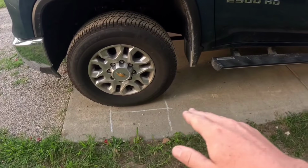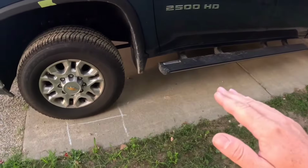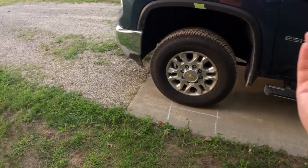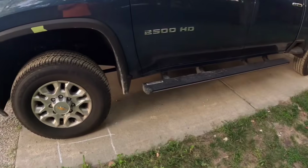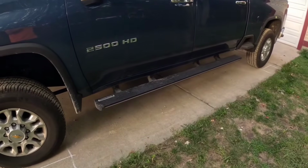And I also mark the tire spaces where I park it, so I can always put it back in the same spot, because after you make some large amount of adjustments, it's always wise to actually go drive it down the driveway, drive it back, give a chance for the suspension to resettle in its new location, to verify your measurements when you're measuring it out. So I'll show you where to measure, adjust it at right now.